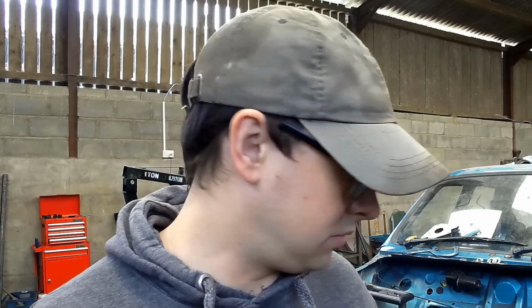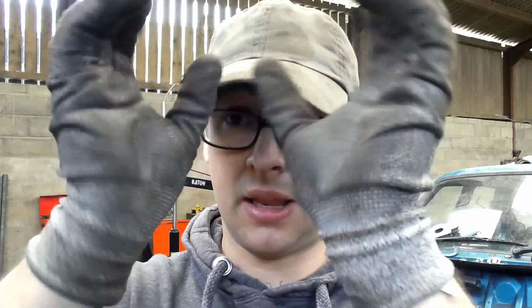So that's why I was just trying to sort them bolts at the back. They seem to go in now. The one's still a bit tight, but there's not really much more I can do. I'll slap some copper grease on it and see if that helps. But if it carries on, what we'll do is cut them gullies out that I've got them on, and make some more, put some new cage nuts in, and put our own nuts in there. Basically, we can position them perfectly then, so I can put them on, lift the subframe up where it sits comfortably, we're done. So, it's cracking on putting the subframe back in.